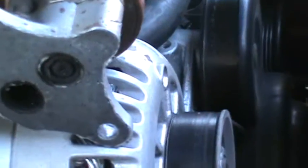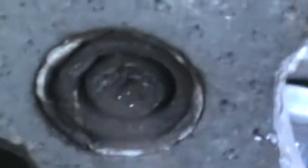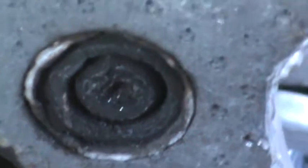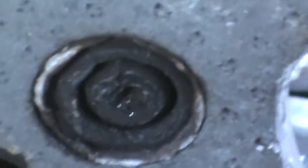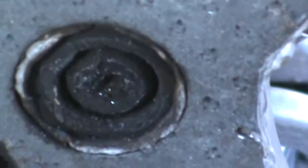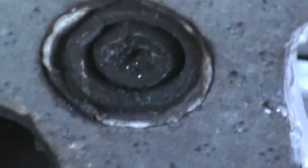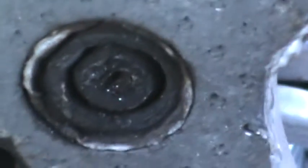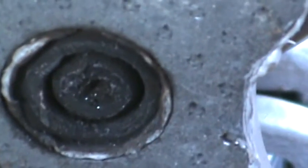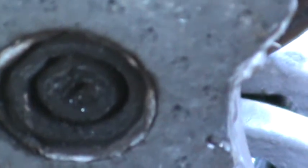You know what? Let me show you first. Okay, so if you look at the EGR valve right here, you can see that there's a plunger type deal right here. Okay, you see that plunger? One is open for the exhaust to come in, and this plunger opens and closes as the computer tells it to, so that it can allow the exhaust gas to get in there, recirculate, and reduce the amount of NOx that's being produced in the cylinder compression cycle of the cylinder.